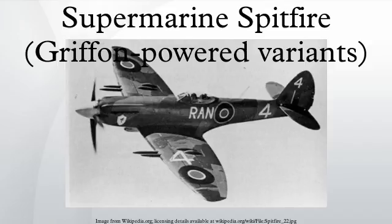As the Spitfire gained more power and was able to fly at greater speeds, there was a possibility that pilots would encounter aileron reversal, so the Supermarine design team set about redesigning the wings to counter this. The original wing design had a theoretical aileron reversal speed of 580 mph, which was somewhat lower than that of some contemporary fighters. The new wing of the Spitfire Mk-21 and its successors was designed to alleviate this problem: wing stiffness was increased by 47%, and a new aileron design using piano hinges and gear trim tabs increased the theoretical aileron reversal speed to 825 mph. The standard armament was now four 20mm Hispano IIs or the shorter, lighter Hispano V cannons, each with 150 rounds per gun.